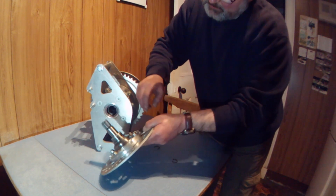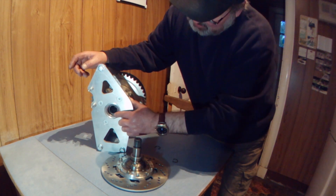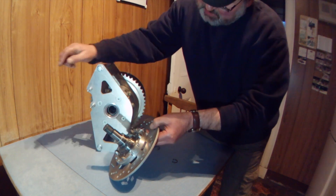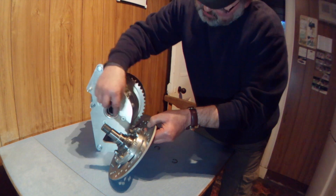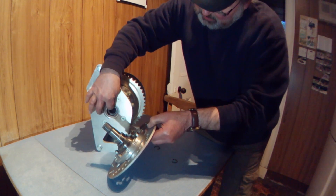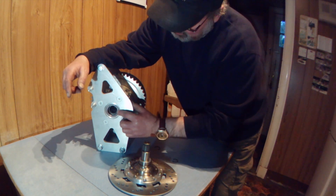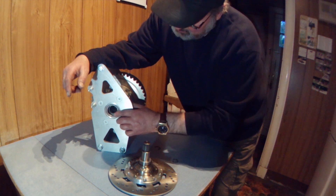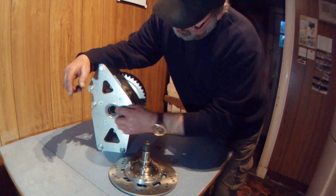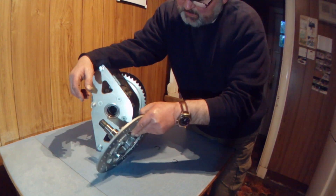It doesn't give a lot of support. And as we're using a disc brake on here, we've added an additional roller bearing — a very slim roller bearing mounted where we would normally fit an oil seal. It rides on the oil seal journal here. When installing this for the final time, if you put a smear of RTV gasket material on the inside of the bearing and on the journal face, that should give you a good seal and stop any grease coming back through that pathway. The bearing itself is a double rubber-sealed bearing, so there shouldn't be any grease coming out. But there's a possibility it could come through between the inner race and the journal, so a little bit of RTV should seal that — not too much that it clogs the bearing up.